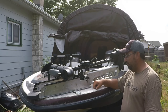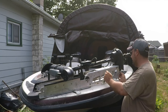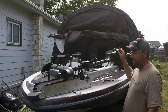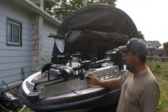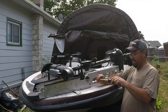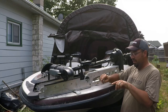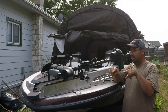When I took the motor off again, deployed it, and locked it back into place, it clicked in no problem — and this stayed perfectly straight. But as soon as you put the motor on, just the weight of it, even with one screw, it would actually twist in this slot — just enough so that the bar inside twisted a little bit. Instead of being perfectly straight, it did a slight twist, making the two pins uneven so they couldn't slide underneath and lock into position.